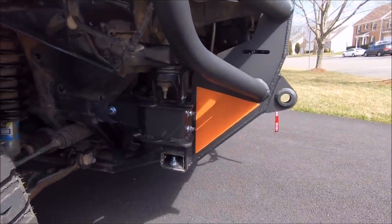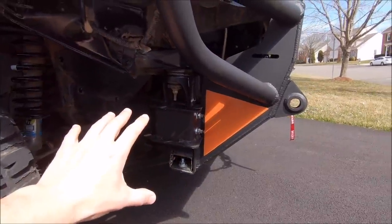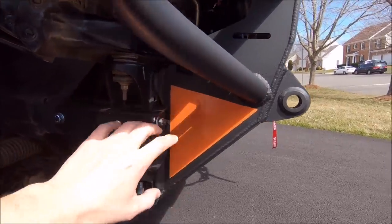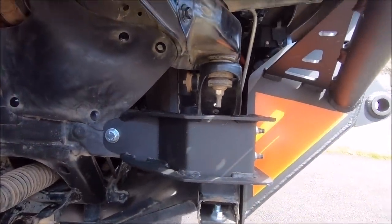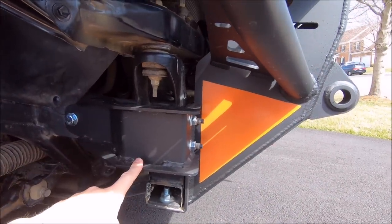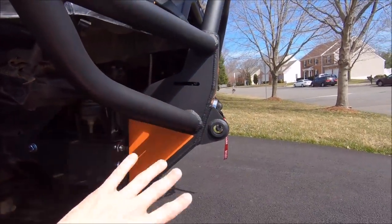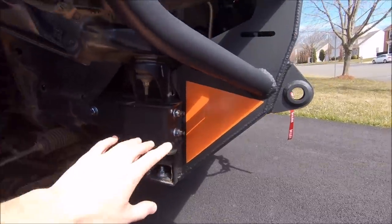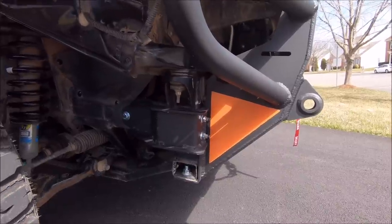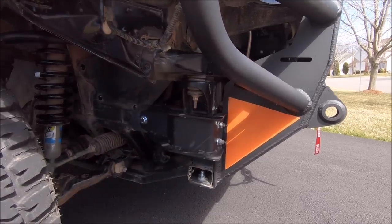Another feature is how this bumper mounts — and this is something I'd caution you on if you're shopping for a front bumper: make sure they have some kind of frame brace that ties the bumper into your frame. You can see this one goes back almost a foot with these super beefy quarter-inch steel brackets, one on either side. If you see a company that just gives you the bumper and it bolts in where your aluminum crash bar was, that might be a red flag — if you really get hit, even in a car accident, the bumper won't be as strong without these frame brackets.